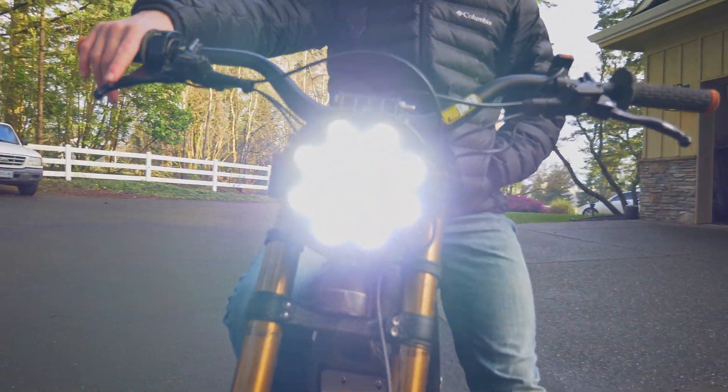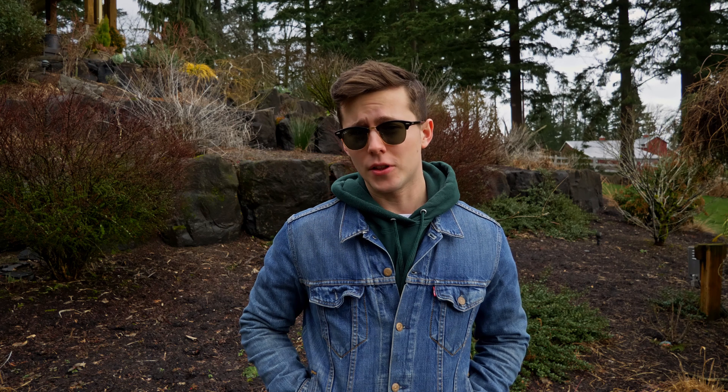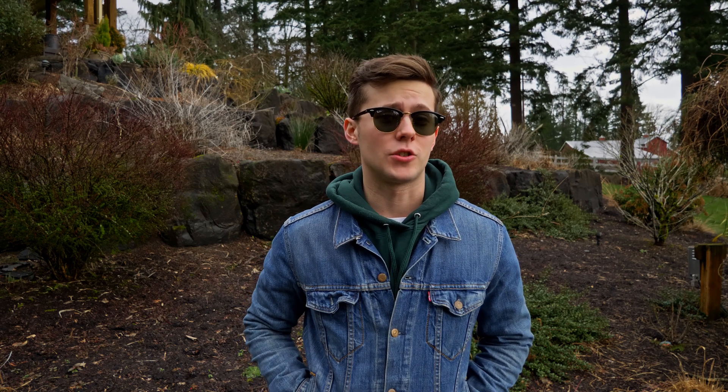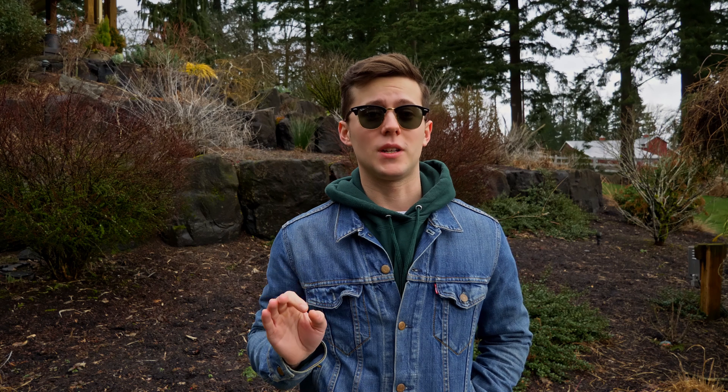We talk often with Suronster — he's another Suron YouTuber with crazy talent. As many of you already know, he got a light speed battery and our ASI BAC-4000 controller kit. Although the light speed battery he has is capable of more than the controller is, we set him up to have 13 kilowatts of power. And even then, he does wheelies on power level 5 out of 9. Controllability for Suronster is more important, as having smooth throttle control and reasonable power levels are imperative when you are doing dangerous stunts on one wheel.